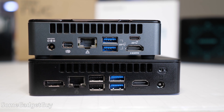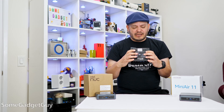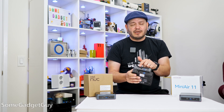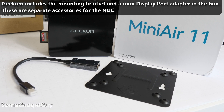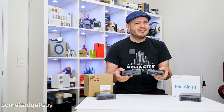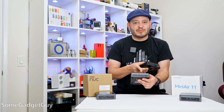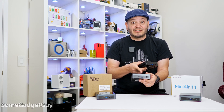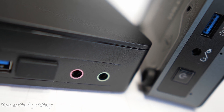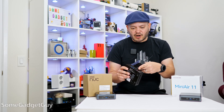We have full-size HDMI on both the Geekom, the older NUCs, and the new NUC, but the new NUC now has full-size DisplayPort. If you want to run multi-monitor, this is a great little setup just to get data to multiple screens — it could be great for signage or corporate use. But I have to wonder, did we really need to make it that much longer just to get this full-size port? I kind of feel like that's a lot of extra space to include just one full-size port, and I don't know how bothered people might have been by using a dongle to go from mini DisplayPort to full-size DisplayPort. Using the extra space, we do get some additional I/O on the front, but I'm not sure how valuable this extra real estate is being utilized. The Geekom and the original NUCs use a combined 3.5mm jack — a combo headphone/headset input. The new NUC moves to separated microphone and headphone inputs, which honestly for a lot of office workers I wonder if that's more difficult — you have to find either a dual cable solution or a splitter.